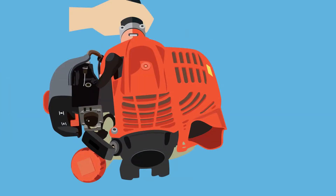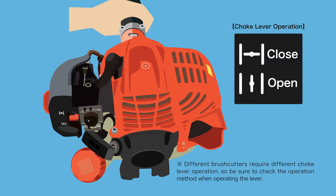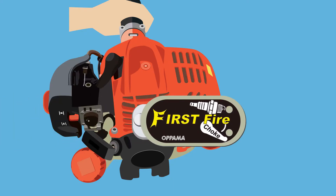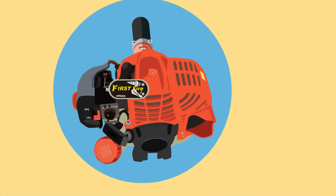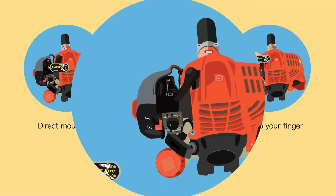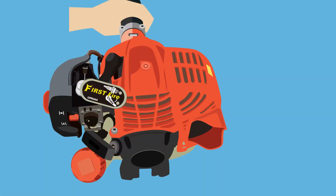It's easy to use. First, activate the engine on switch on your device and fully close the choke. Now clip the PET-4200 to the engine and put the sensor portion of the device close to the plug. If you cannot clip the PET-4200 to the engine, you may clip it to your finger or otherwise attach it with antenna wire. Once you've done this, you're ready to actually use the device.